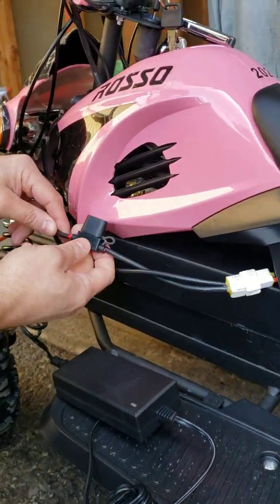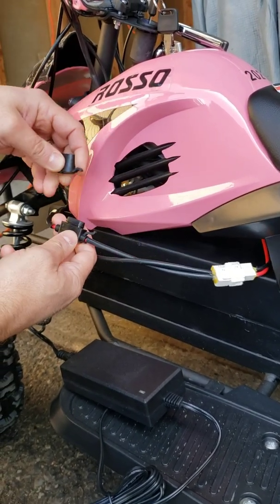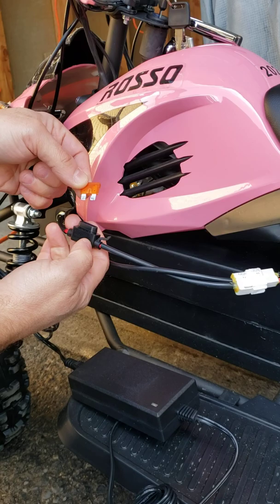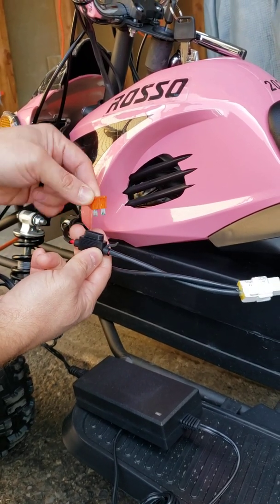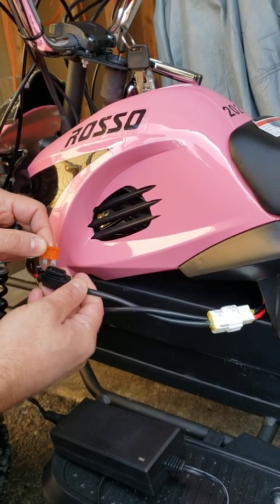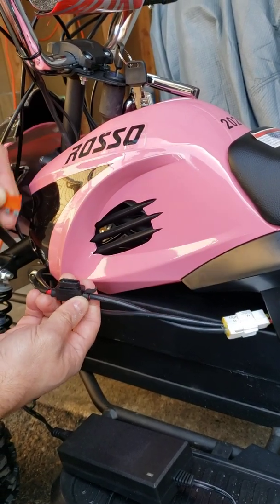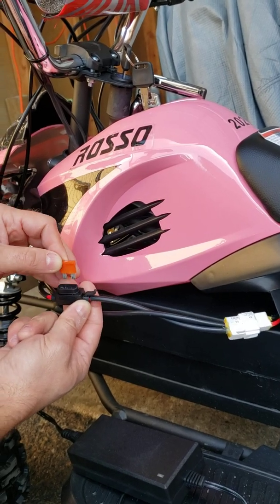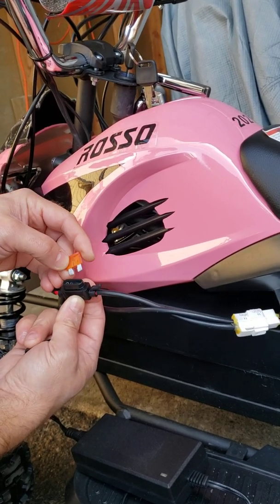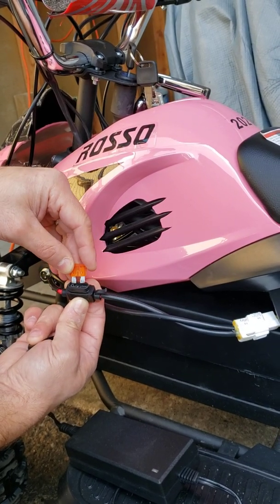Your fuse is located on the main wire coming from the battery pack. Once you open this cap, just inspect the fuse to see if it's not blown. Maybe it's going to look okay from the outside but it's defective internally. But if you replace it with a new fuse and your battery is okay and producing power, you're supposed to receive a confirmation sound once you install this fuse. You're going to have a little spark right here when you're installing it. That means power is getting through okay — don't worry about that little spark, that's normal.